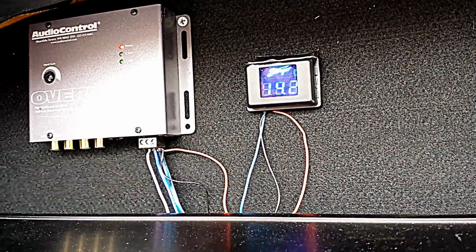Just showing you — like with batteries, a battery does not like to discharge as much as these caps do. These caps don't have any kind of reserve like a battery does — they like to dump as much current upfront as possible, but they're not good at it over a prolonged period of time. That's why they work well with batteries. Batteries really like a more prolonged, slow draw over a period of time. So the more batteries you add to your bank, the easier it is on each individual battery and the better everything performs. These caps are fast burst caps — they're good for burping, but they're not good for car-off use.